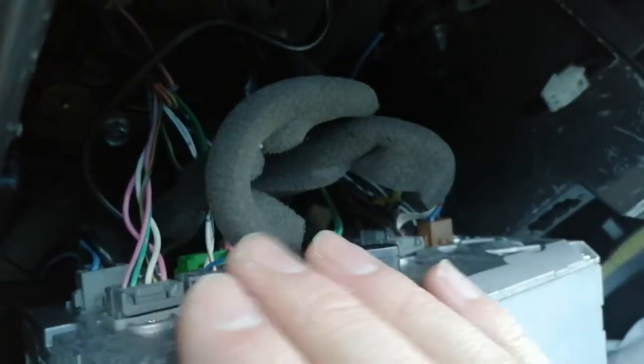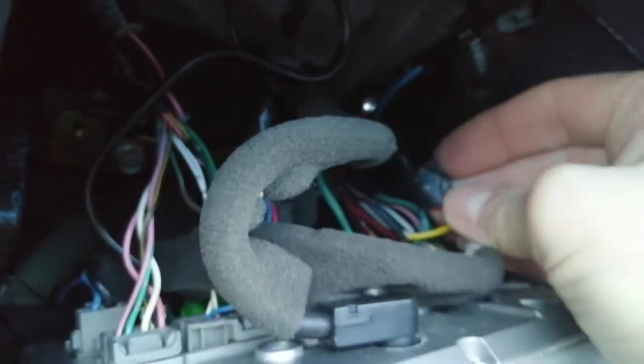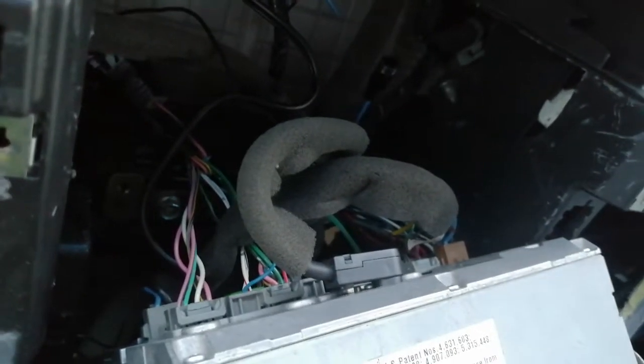Here's the rear of this particular stereo. We're going to need to unplug all of this. This one unfortunately has been messed with so it's not a great example, but I just want to show you the basics of how you remove the radio on this — it's pretty straightforward. So this is your dashboard upper section — normally sits like that with the radio on the rear.